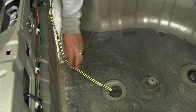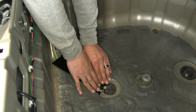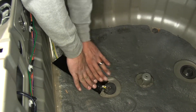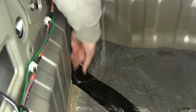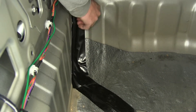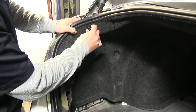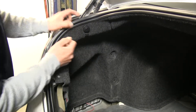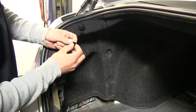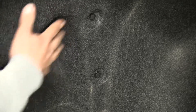Since our wire is going to be sticking up right here, I'm going to take some duct tape — it's not included in our kit and isn't required, but it's a good idea to have the wire attached to the floor so it won't get caught and we won't have to worry about it pulling up. Just take some tape and go along the wire securing it down. With all the wires ran back here, we can put our trunk back together. We can start by putting our tie-down hook back in place — push the outer section in and then push the center section in to lock it in place. The push pins work the same way: make sure the center section is still pulled out, then push the center section to lock it in. We're going to repeat that for all the remaining fasteners.